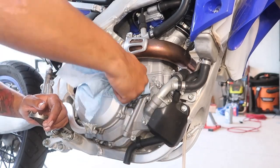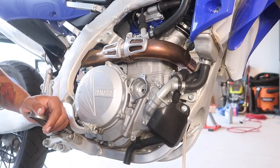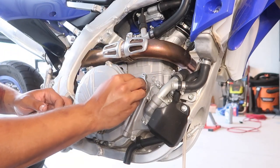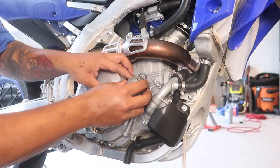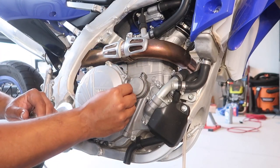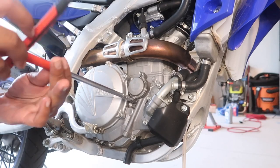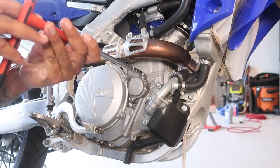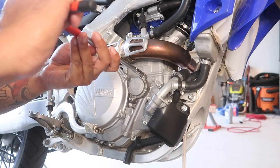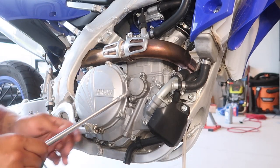The oil has already drained, and we don't need to tilt the bike or anything. Make sure the area is clean so nothing spills on the floor. We're going to get the new filter and put the empty end inside just like that. Bolt on the bottom, bolt on the top. You just want to go a quarter turn after it is hand tight — you don't want to strip those bolts — and then we're good to go.